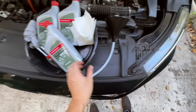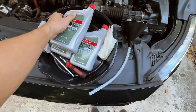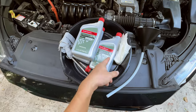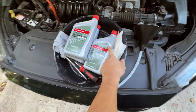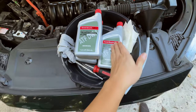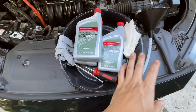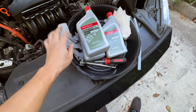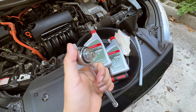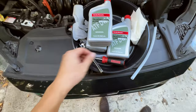The second thing you need is transmission fluid — use the genuine Honda ATF DW1. You need 2.1 quarts, and unfortunately you can't buy 0.1 quart, so you have to buy three bottles and use just a little bit of the third. As you change it every 50,000 miles you can probably reseal and reuse that partial bottle. You also need gloves and a square socket to unscrew the transmission fluid drain plug.